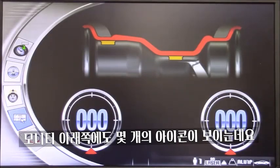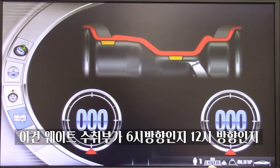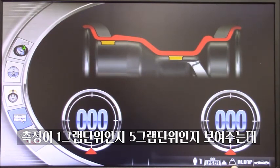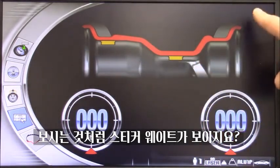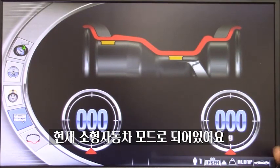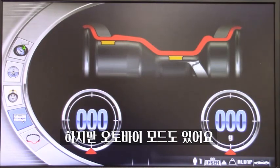Also on the bottom right of the display, you can see a few other icons showing what we are currently working with. It shows the operator number, whether the laser is on, the program selected for weight position — which could be 12 o'clock or 6 o'clock in this case — and the kind of rounding, so fine reading in this case. We also see the program we are using: ALU1P, indicating tape-on weight. If we had clip-on weight, this would say dynamic. And finally the mode — normally car mode, but remember this machine can also be used for motorcycles.